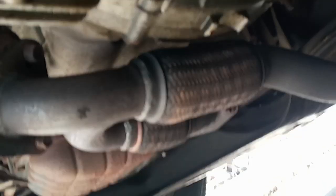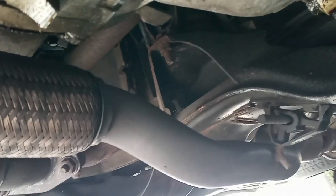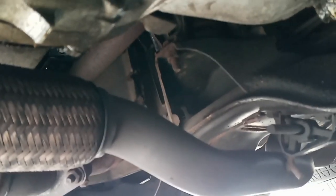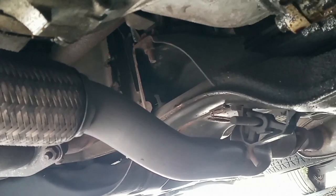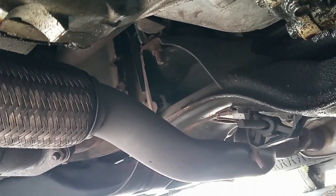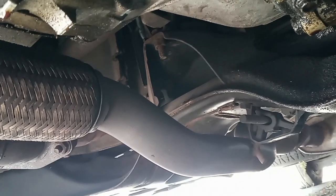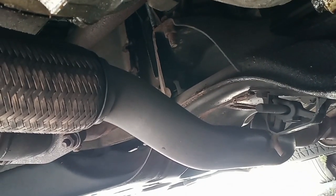Hope you can see. Just to let you know real quick, this is a 6-cylinder. It may sound confusing, but the bank 1 side has 3 cylinders: 1, 3 and 5. And bank 1 side carries 2 oxygen sensors and 1 catalyst. Altogether this vehicle has 2 catalysts. So there you would have an upstream and a downstream sensor, okay.